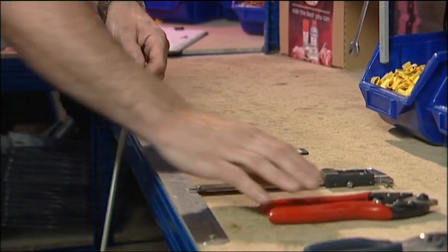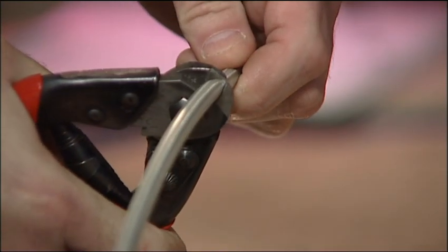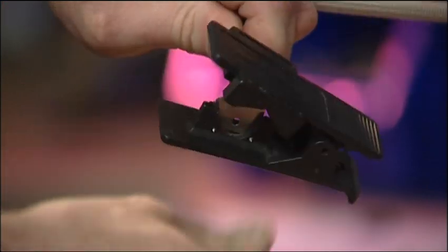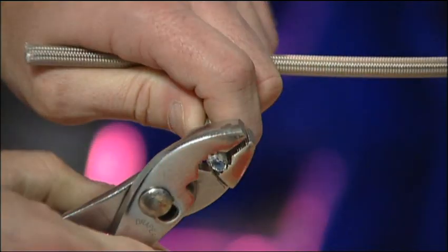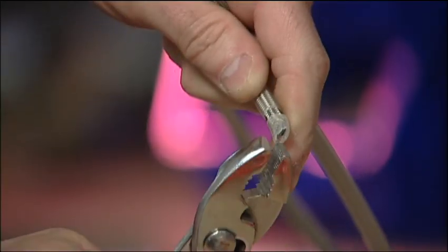Hel Performance have thousands of motorcycle and car specifications. Each hose is cut to the correct length. An 8mm piece of PVC covering is removed from each end of the brake hose, so that we swage directly onto the stainless steel braid, which adds security and integrity to each brake line fitting that we attach.